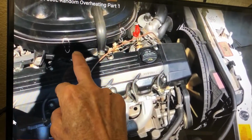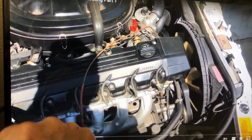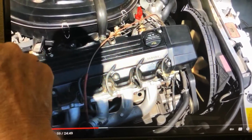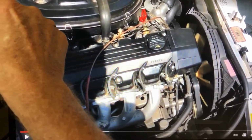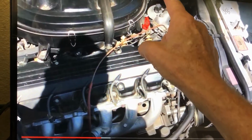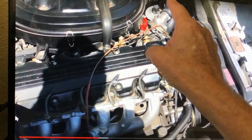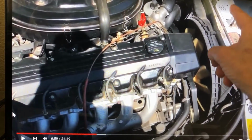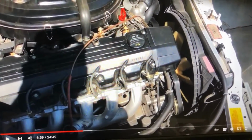There's a coolant sensor here that goes to the push button unit in the dash, and it sends a signal to the relay in the fuse box, and that signal turns on the power, and it travels along to a ballast resistor by the headlight here, and that allows power to go to the auxiliary fans to turn on and off, depending on engine temperature.